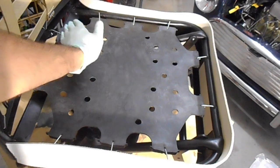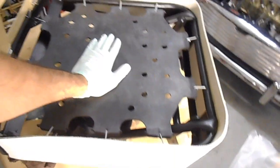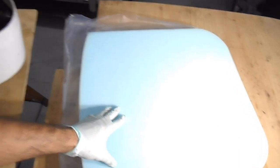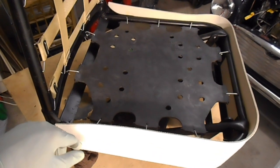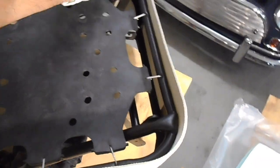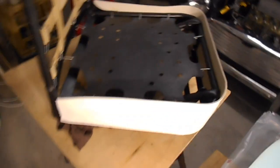We don't want that gap because it makes the whole seat look like it's all mounded up. We want it to sort of sit level. I'm going to add some adhesive around the edge, a little bit in the middle, a bit on that edge too, and then get the piece of foam in there. The size of the foam is slightly larger than this hole, and that's why you need to glue it - you need to push it in and make sure the edges get stuck down. The back edges are curved and fit in nicely into this gap, and the front sections have a nice circular curve on them that fits in there. So let's get this stuck down.